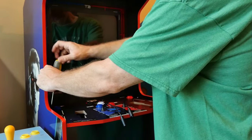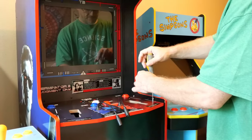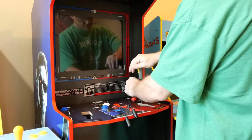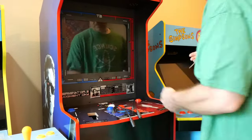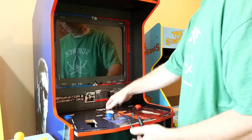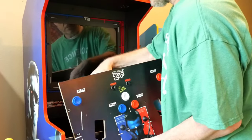With both the firing arms and holsters disconnected, we can begin removing the four screws from the four corners of our control deck. These four screws should come out with ease — please remember not to force them. Once removed, place them off to the side in a safe place.